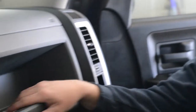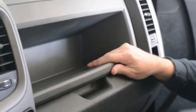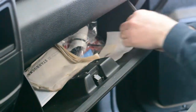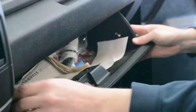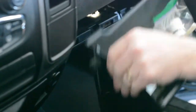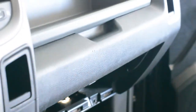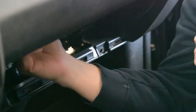Here's my cubby — the only thing I use it for is holding my hang tag. To get started, you've got to release the glove box. It's got a little clip on the side that's pretty easy to pop out. You just push forward, then squeeze the sides and the glove box pops right out. Then we'll get into removing the bolt that's inside.